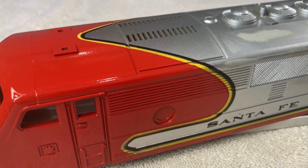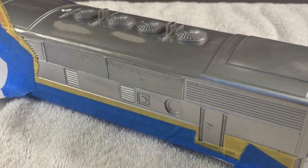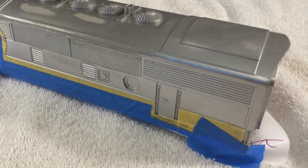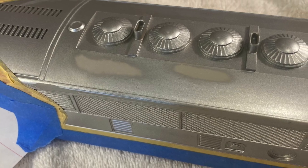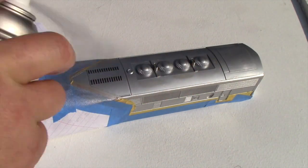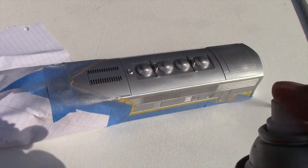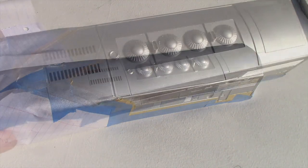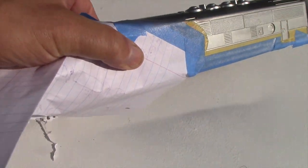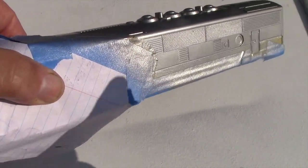My work here is not done, my friends. I need to fix the rear areas too, and I saved that color for last. Because of the metallic finish, I learned years ago not to mask any resprayed silver paint. The tape would actually lift away sections of the little sparkly flakes and leave blemishes. So now, silver is always the last color I spray.